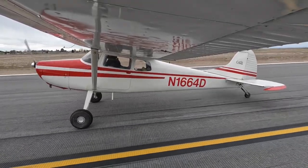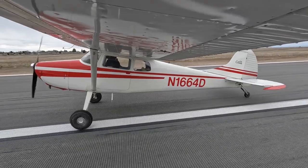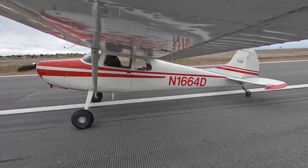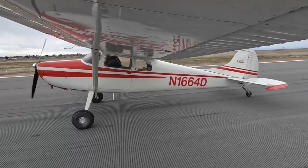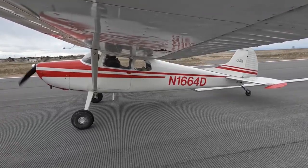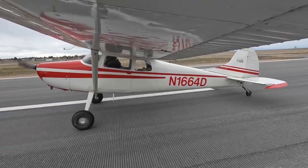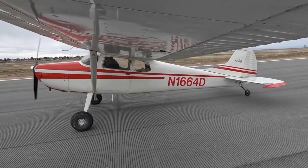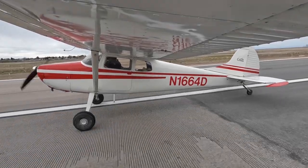We need to make sure that we don't just force the tail wheel down and hold it in the shimmy. We'll break the tail wheel every time if we try to do that. So remember, if you are flying a tail wheel and you do get that shimmy, a lot of times the best answer is lift the tail. See if you can bring it back down more gently, or multiple times, to get it to go straight — and give that a try.